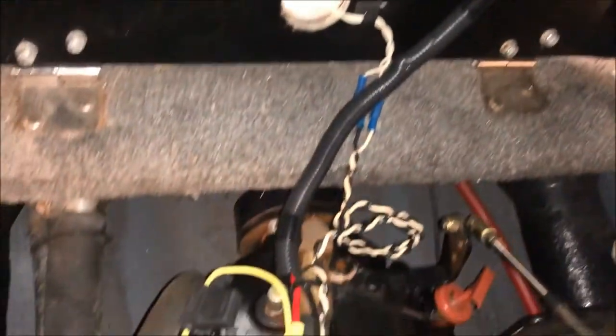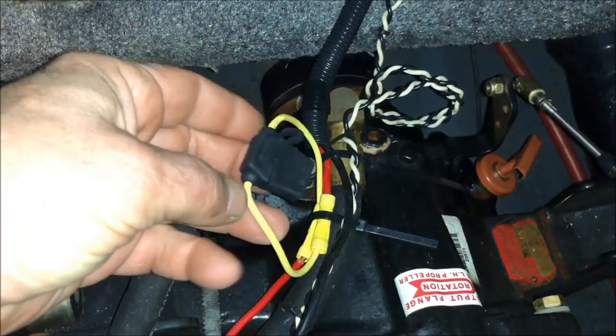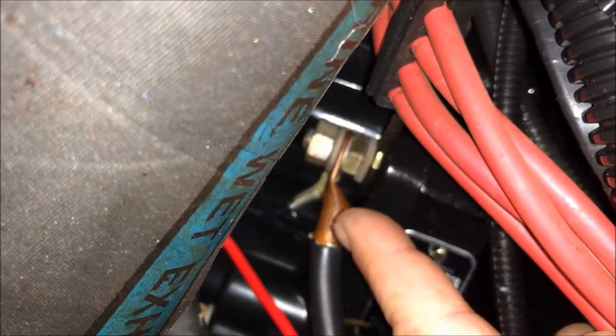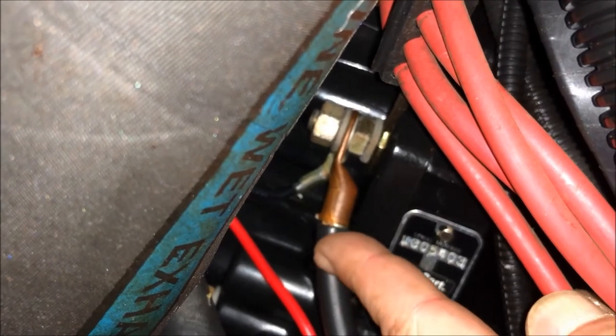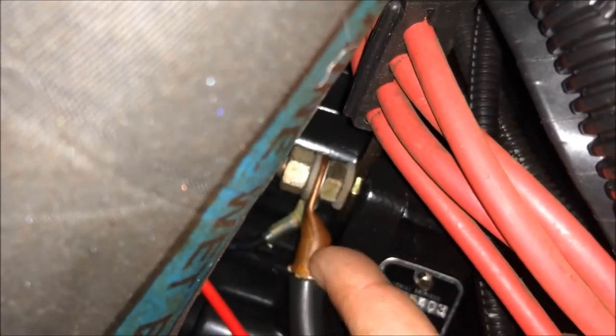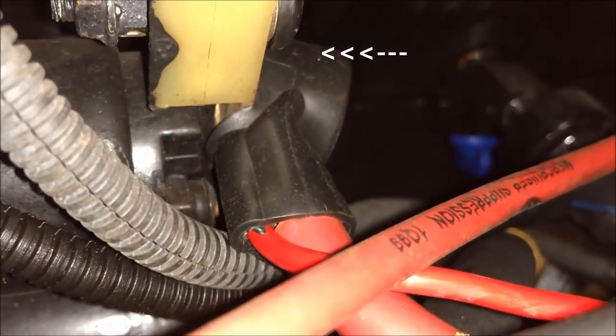I ran that wiring down to some voltage lugs and made sure to use a properly sized fuse with heavy gauge wire that can handle the amperage of that pump. Right here you'll see that I used a lug in the same location as the engine ground to get my ground to that power port, and I ran my wire with another lug to the starter solenoid where I get the permanent hot, so I always have power to that power port.